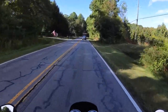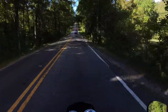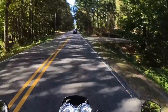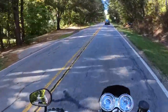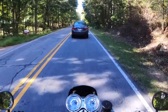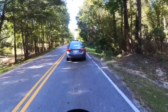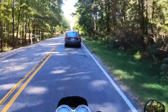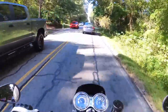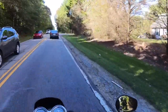I wouldn't put sport touring tires necessarily on an R1. When you've got a bike that is just that fast and powerful, and that's the only kind of riding you're going to be doing, then yes, you go get the supersport tire. But today's sport touring tires, the Angel Pirelli STs, the Roadsmart 4s from Dunlop, these Road 6s, as far as sport riding goes, they're every bit as capable as Michelin Pilot Powers and Dunlop Q2s and the S21s, the tires that were the supersport tires two or three years ago. These are going to be as good as that, but give you much more life.